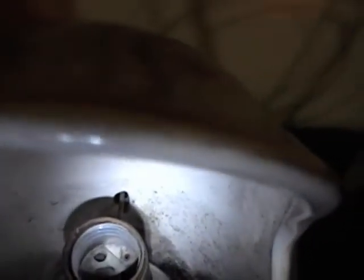The cord looks sound. I don't see any breaks in it or kinks or cracked insulation. So I screwed in a bulb and tried to turn it on but nothing happened. I've been taking a closer look. I think it just might be that the center contact on that socket is just so filthy and corroded it's not making good electrical contact. Time to bring this into the workshop.